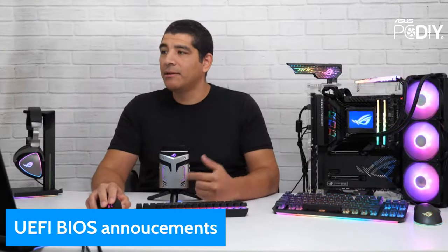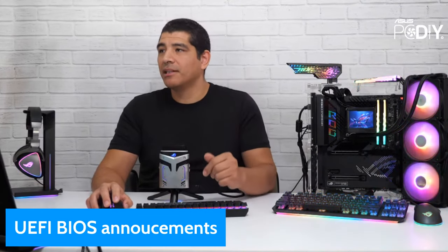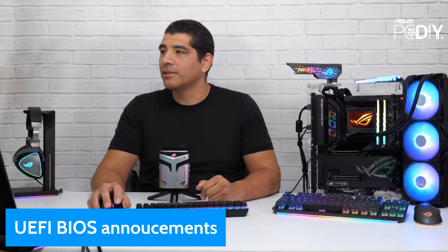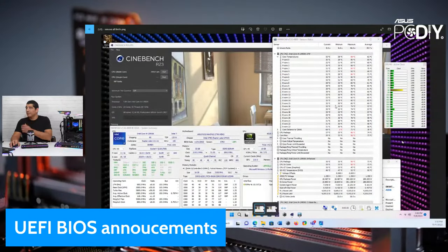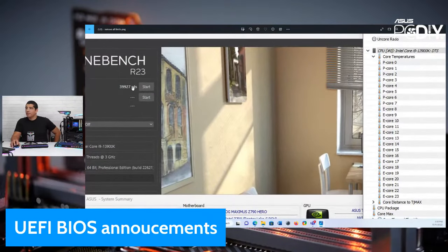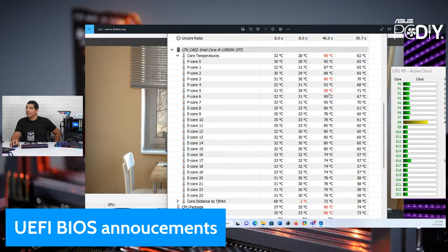Let's look at the performance comparison. Here I have the results for remove all limits running Cinebench on the Maximus Z790 Hero. Looking at peak temperatures we're getting close to 100 degrees, with core readings of 98, 90, 87, 88, 96, 92, 98 — so you can see the overall reference for that type of load. Again, if you're doing gaming or desktop usage you will not see these temperatures. Gaming workloads typically land in the mid-50s to mid-60s, with maybe rare scenarios in the 70s, also influenced by ambient temperature and airflow.